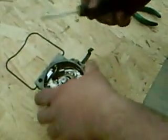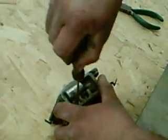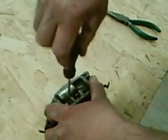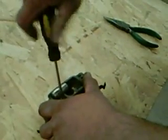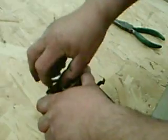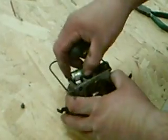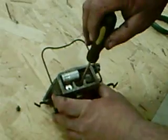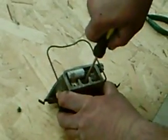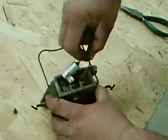It doesn't really matter exactly how you take this part in order. I prefer to remove the condenser from the top first and get it out of the way. I probably should have prepared myself a little better by loosening some of the screws like the professionals do, but I didn't. That was the screw that holds the hold-down of the condenser, and then there's the big screw on top where the coil wire attaches. That loosens up and you can remove the lead from the condenser.